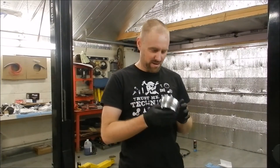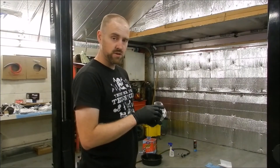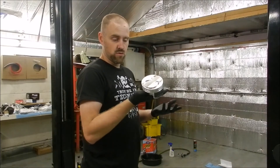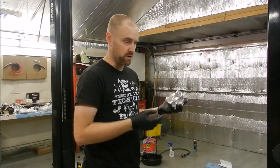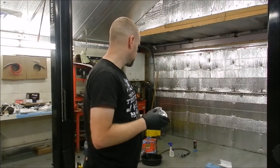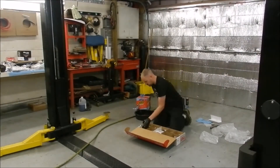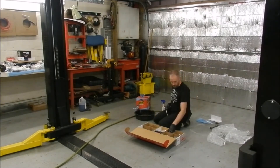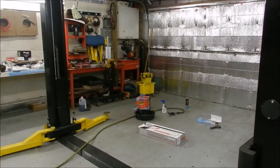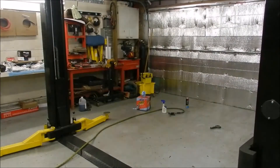I'll go ahead and put these back in the box and get them cleaned up. They're new, I get it, but I still clean them just in case there's somehow a little chip of something from his shop in there. So I'm still going to clean them, then put them back in the box where the other parts are. Another note I want to make: normally this guy takes the wrist pins too — he goes as far as the wrist pins. Normally when I get this box from him, he has the wrist pins sitting with the piston, because sometimes the wrist pins are just a little bit off — half a gram or whatever. So he'll match the wrist pin weight to the actual piston weight to make it as close as possible to being exactly the same on all of them.